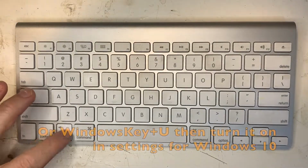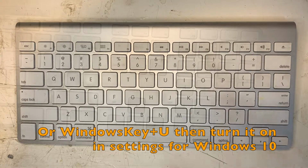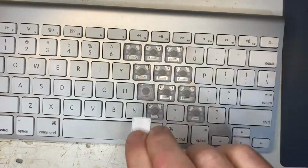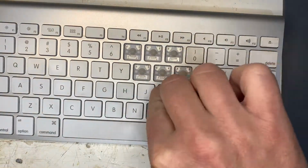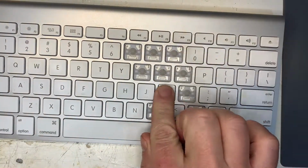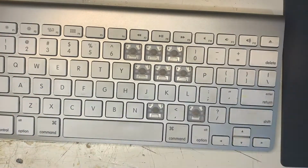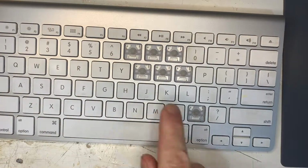If you press Alt 5 times it will turn on mouse keys. On a full-size keyboard, mouse keys uses the number pad to control the mouse pointer, but on a smaller keyboard like this one, it uses 789 UIOJKL as well as M and the greater than key for right and left click. So to be sure, press Alt 5 times to turn it off, or otherwise check if mouse keys is enabled, or try it on a different computer.